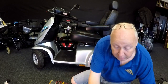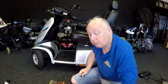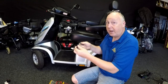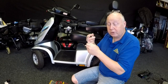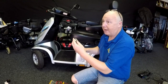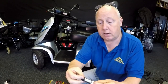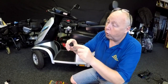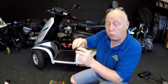The annoying thing with this particular scooter — and it's very rare — is most scooters have a charger connection of the three-pin with a three-pin female, so the charger will plug in here. If you need these connections, let us know — we sell them, they'll be linked below. All different connections for all different scooters, pre-wired. You can also have a plastic connector and a metal one. This one has a little clip here, so when you push the charger connection in you've got to release the connection. When you tighten the plastic ones up, don't over-tighten them — you'll start breaking the edge bits. Just tight and that's it.